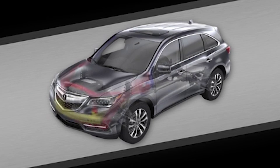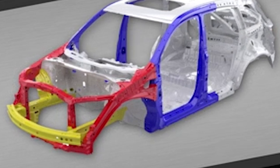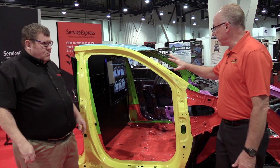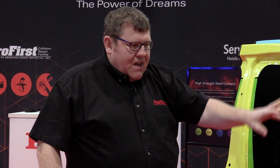Now this piece is located actually under the aperture skin, under the outer panels. Aperture damage might be repairable in some instances, but if it gets into this area, it's non-repairable. Is that what I'm hearing? Correct. Once this ring is damaged, it must be replaced as a complete unit.